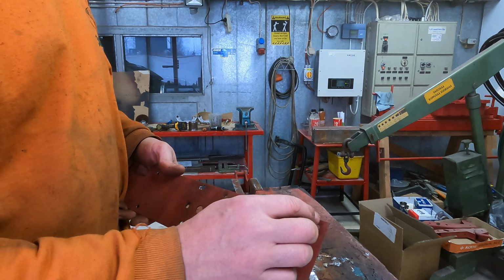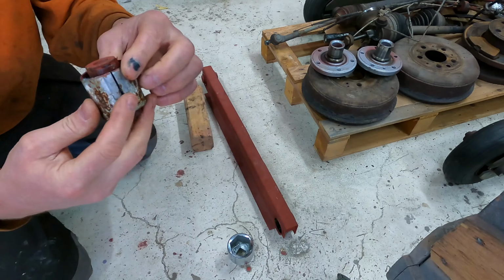So I'm measuring this one and it's actually the same size as the front wishbone arm. The rear bush is exactly the same size. So I found a way of hammering it off, and the first one already slips in the first hit. Big socket, you know, it's a 50 millimeter socket. And this one is 32 millimeter, which fits going inside this outer sleeve, but takes contact with the bushing sleeve. So I'm hitting like this. It's sliding off. And I think now it's bottoming there. Yeah, the first one is off.